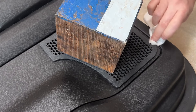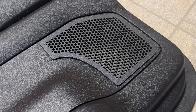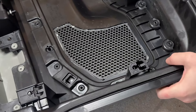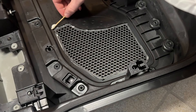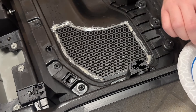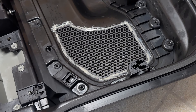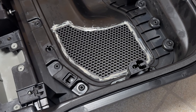After it's set, flip the panel over and apply additional epoxy on the back side, filling all the cracks for a stronger bond. Let this fully cure in a warm environment before installing the panel. When you slam the panel in to pop all the clips, you could pop the grill out or break something if it hasn't fully cured.